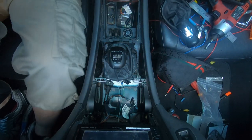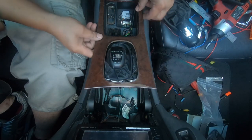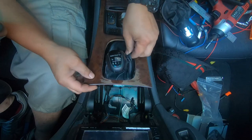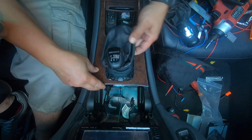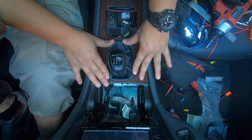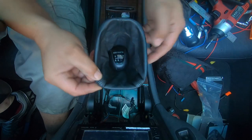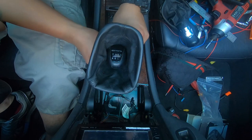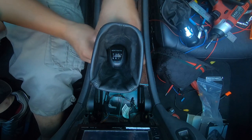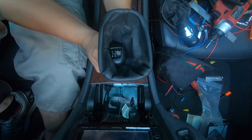Right now I don't have anything here, but usually this would sit in like so. Your boot would sit in between here, so this would clamp down like so. And your boot would just sit in it like that. All you have to do to remove your gear knob is pry this part up, and then at the bottom of your gear stick you go clockwise to loosen and counterclockwise to tighten. I'll show you after I remove it. So you go clockwise and then you pull down, and all you have to do now is lift your gear knob up and it comes off.